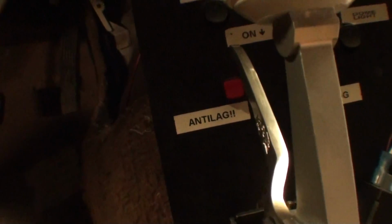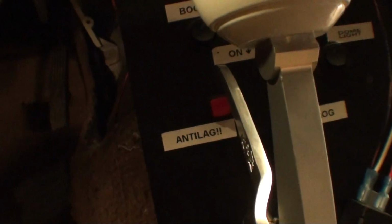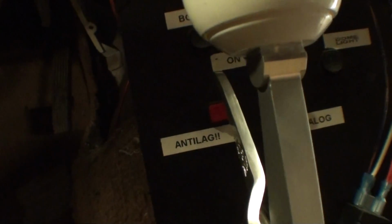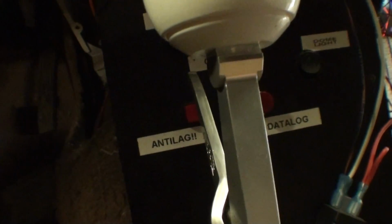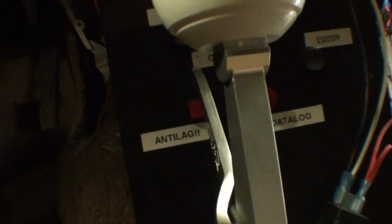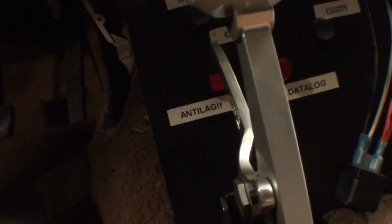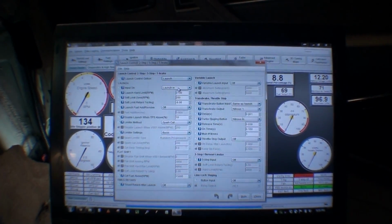It just grounds the input wire. So one side of that's going to launch in, the other side is going to a regular ground on the car. It can be a dirty ground, it doesn't matter. I'll quickly reference that. Dirty ground means chassis, battery, whatever. Clean ground usually means it has to go to signal ground, or the ECU ground, or sensor ground, whichever you want to call it. The ECU actually has its own clean grounds that go to very sensitive sensors, and then there are other grounds like relays and other stuff. To mark these inputs off, all you need is a dirty ground.